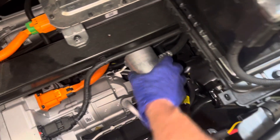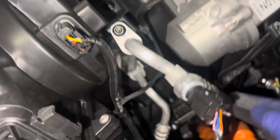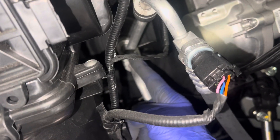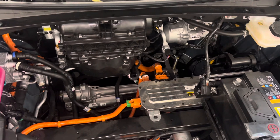The discharge goes through the muffler — big muffler too — and following it down here, my fingers are tracing it around, and we're coming up here and we're going into the dash. Now you might think no big deal, they all go into the dash, but look at the size of these lines — they're both identical. That means basically no pressure drop, but we are going to get rid of heat because the customer wants heat. There's a heat exchanger in there giving off heat.